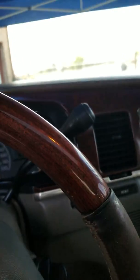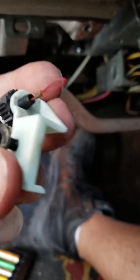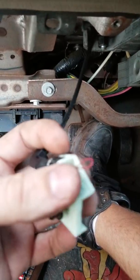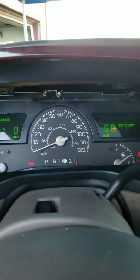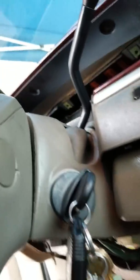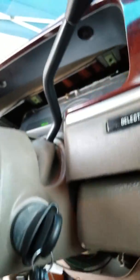You'll need a seven millimeter and a Phillips. There's a little cable that drops down — this is for your shifter right here. This is also a pretty small bolt. It hooks on the actual shifter which indicates what gear you're in, and it wraps underneath the cluster, so you'll have to take it out with a Phillips screwdriver.